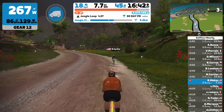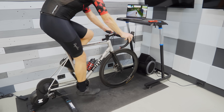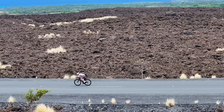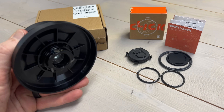The main benefit here is that the Zwift Cog is compatible with any bike out there. When Zwift sells you this trainer, they don't ask you which type of cassette you want — 8, 9, 10, or 11 speed. They just give you this and it's compatible with everything. It also has benefits if you have a mountain bike or something geared towards high inclines. On the flats in Zwift, it gives you more flexibility because you have a virtual cassette range. The last benefit is that you can easily swap between different bikes with different cassettes. In my case, I have 10, 11, and 12 speed bikes, and we can all use them on the same trainer without ever swapping cassettes. Existing Zwift Hub owners can buy the Zwift Cog for $79, and that also includes the Clicks in the package.